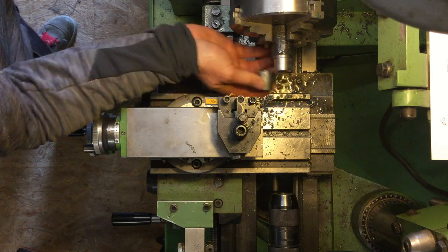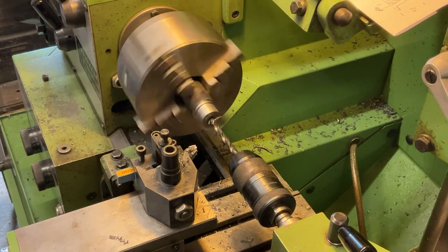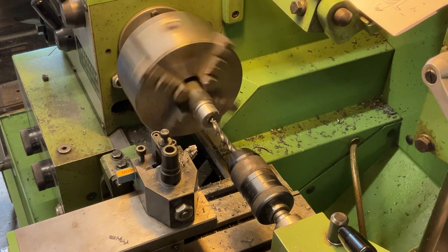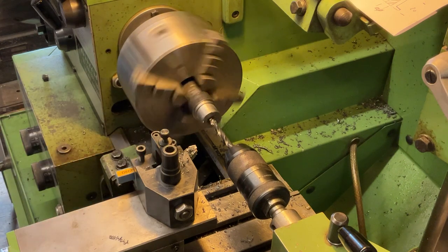After having reached target sizes, I recheck with the bushing. If that is satisfied, I continue with the drilling. Starting off with 6 mm, continue again with the 10, finishing up with 12 mm to match the threaded rod at the end.